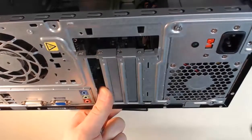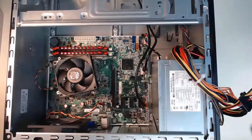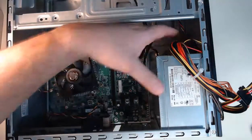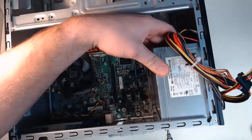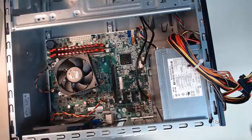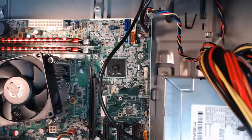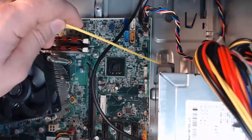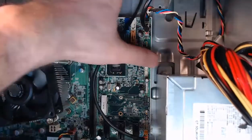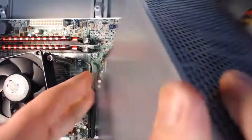This is that moment where you stop and make sure it's not going to fall literally into the case at a vertical angle. My power supply actually has a lever down below that's keeping it locked in, so even with one screw left it's not shifting. That's not going to be common for every single computer case, so keep in mind it might be a good time to hold on to the power supply as you take out your last screw. The last screw is out, and my power supply is not moving — it's still locked. Down here at the bottom corner of the power supply, there's a locking lever preventing it from moving into the case. I'll depress that lever with my thumb, and the power supply comes right out.